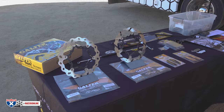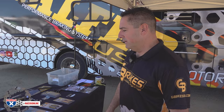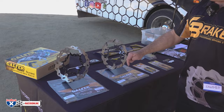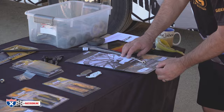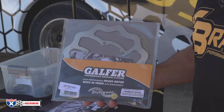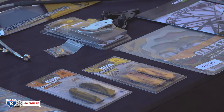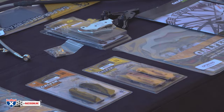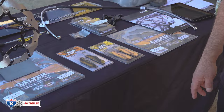Hey, Sandra here with Galfer Braking Systems. We're going to do a quick overview of the Galfer product line. All Galfer rotors are 420 high-carbon stainless steel, double disc ground, never stamped, and heat treated for every specific application. Versions include floating with the tsunami cut and non-floating. It really depends on what kind of riding you're doing when choosing through the product line and figuring out what performance you want. We also have race pads and regular everyday brake pads.